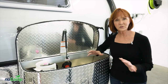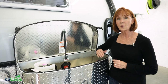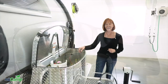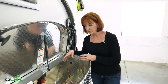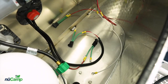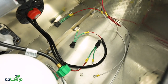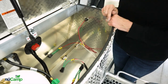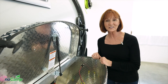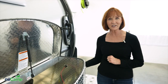Turn it back to the right when you're using it so that the system can charge when you're connected to the vehicle, when you're plugged in at shore power, or with your solar panel. Most dealers will provide you with a battery on this side of the compartment. You can see there are several different fuses here — one is for the battery and the other two are connected to the solar panels. You have a 105-watt solar panel on the roof that will be charging this battery whenever it's in the sun, and another portable solar panel plug on the side of this tub.